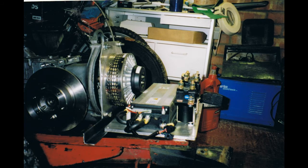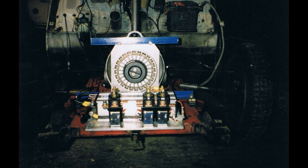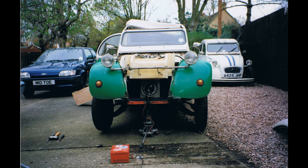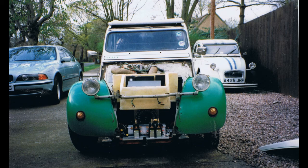You can see it's just under the motor there. I've added the top mount on top of the motor, which was to actually locate the battery box, because half the batteries were in the front under the bonnet and the other half were in the back of the car. The battery boxes were made out of foam, glued together and then put two layers of fiberglass over, becoming a really solid box and quite well insulated. I had to cut corners out to clear the lamp bars because access was very tight there. And you'll see it with the batteries in.